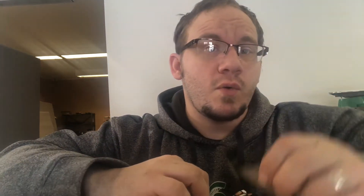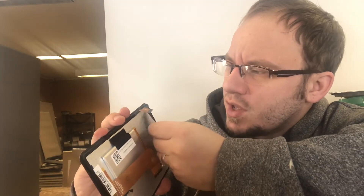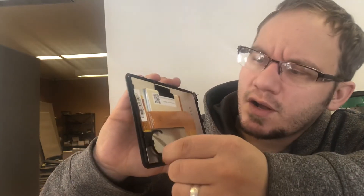Half of this thing is a sticker and the other half is a circuit that does your Wi-Fi. Everything's free — we've got that off. Now we're down to the LCD and the battery. Looking around here there are just clips — one, two, three on one side, looks like one on the bottom, but it looks like that speaker housing holds it in, so we might have to pop those out on the top and then slide it out.